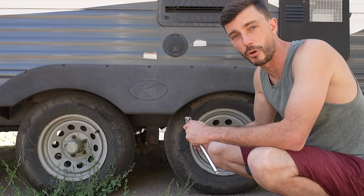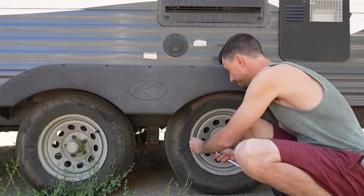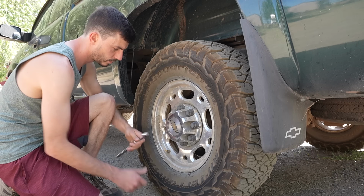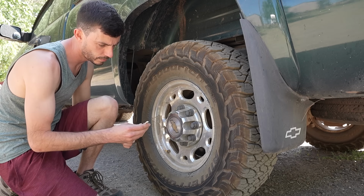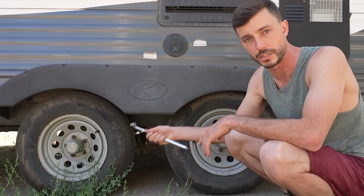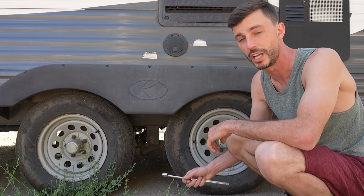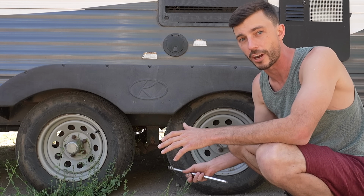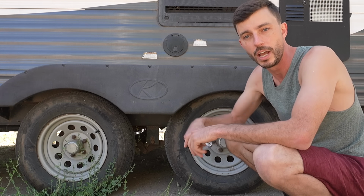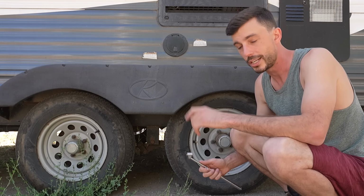And something that's extremely important to check is your tire pressure, especially for long hauls like I'm about to go on. I always check the tire pressure in all 4 of the tires on the travel trailer and my 4 tires on the truck. Underinflated tires is one of the biggest contributors to tire blowouts because heat kills tires. And if your tires are underinflated, then they're gonna get hot rolling down the road. After all these years, I've never had a tire blowout. I've been full timing for 8 years now. I've traveled well over 100,000 miles towing, never had a blowout, so check your tires, guys.